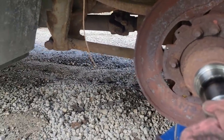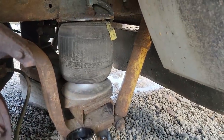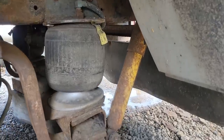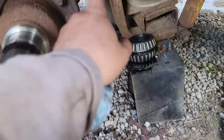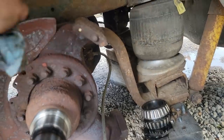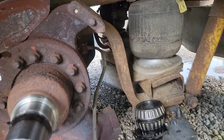It's got an air ride suspension with fairly new airbags. The rear shocks have been changed but they're not matching - I'll price them out and see if he wants to do them. There's a broken parking brake cable up front. I called our friends at AMI, who supply our International parts, and they got us all set up. We'll also need to replace the brake hose line from the differential to the frame - that's not looking great either.